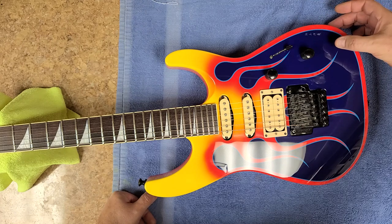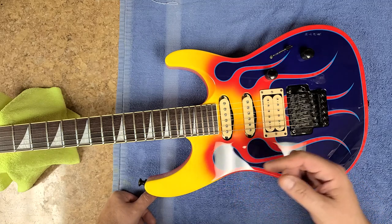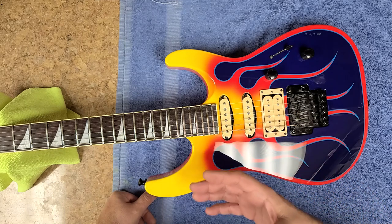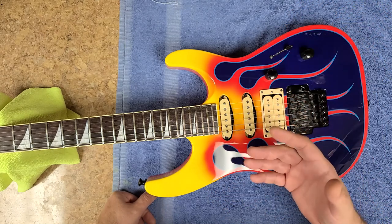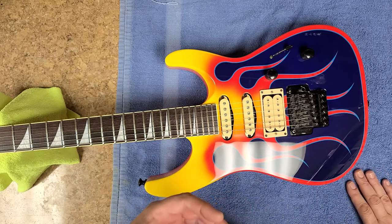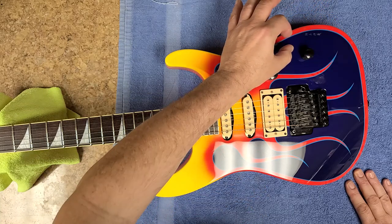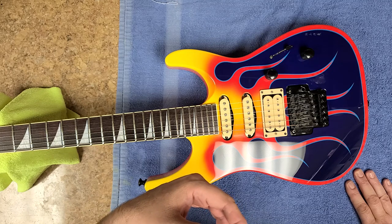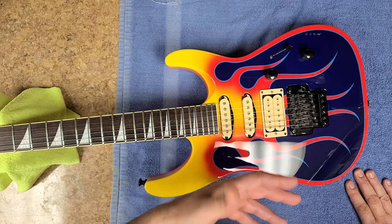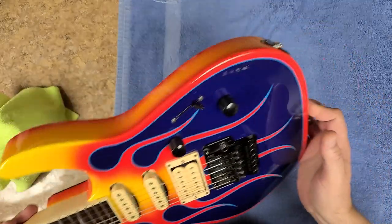So what I ended up doing is the drop fill with the rolled up tape cover so the tape didn't make a really solid tape line. I'm going to go and pick up the actual foam tape that is used for this — when I roll up a piece of tape to fog in an area and not have a real sharp tape line. They sell it by the box or by the roll in different sizes. It's got a little bit of adhesive on one side and it's actually flexible because it's foam, so I can go around edges a lot easier than masking tape, which folds when you bend it so you can't get that edge really good.